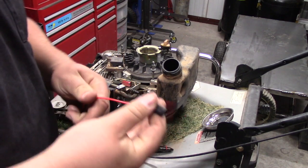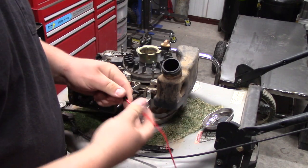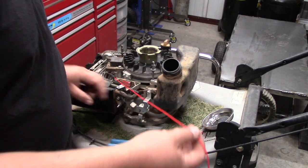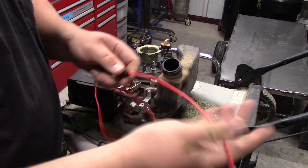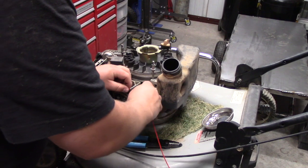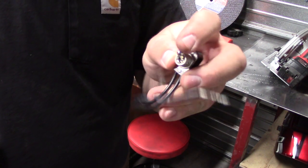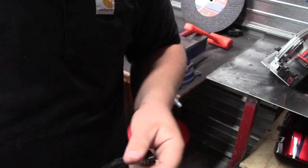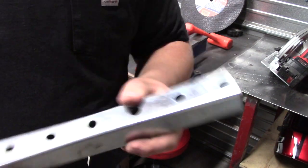Now I'm going to take a little piece of heat shrink tubing and run it down over that connection, where I will then heat it and shrink it later. Run the wire through my little piece here for looks and for support, plug it back in there. Here's your toggle switch — I bought these off Amazon for about $1.50 a piece. There'll be a link in the description below. It doesn't have to be a piece of square tubing, but this is going to work just perfectly for me.